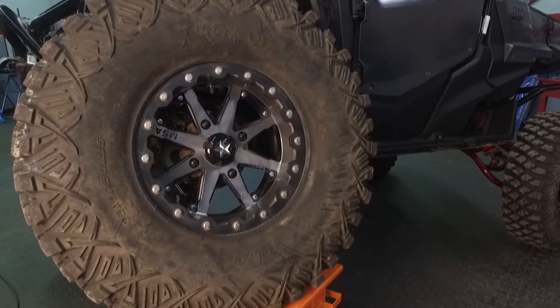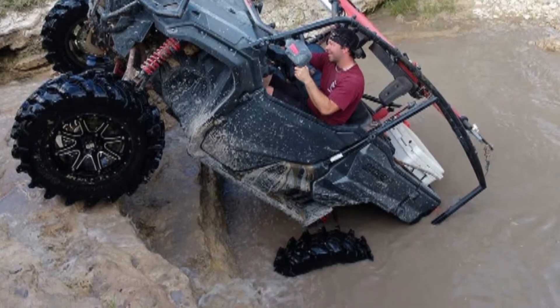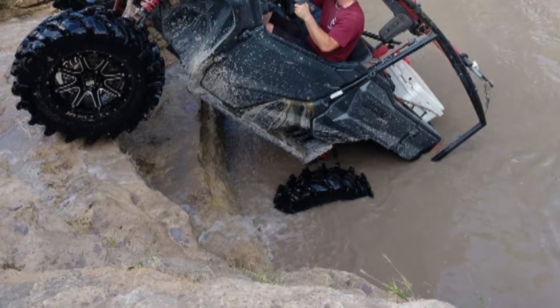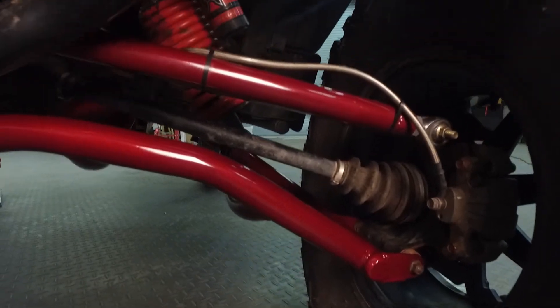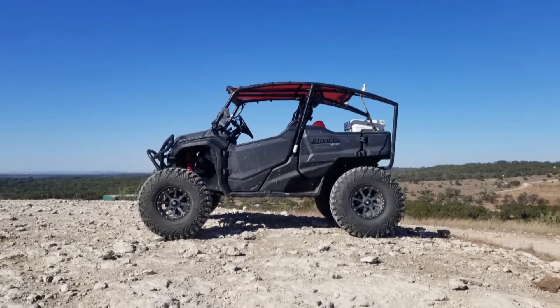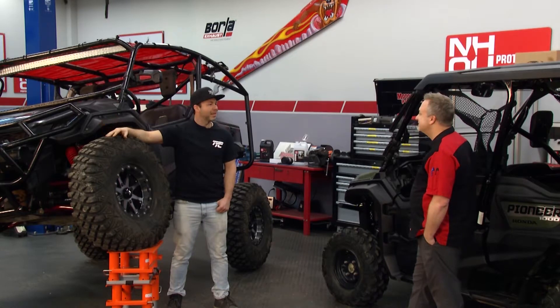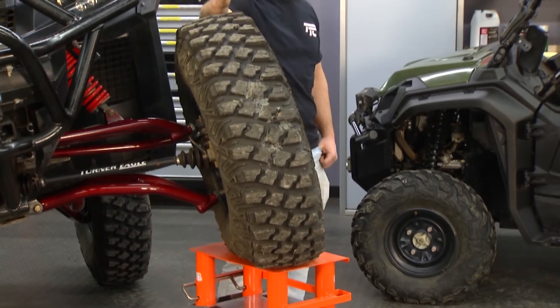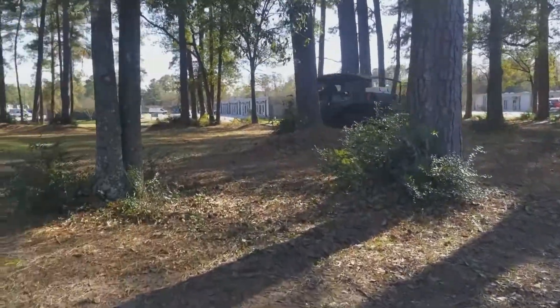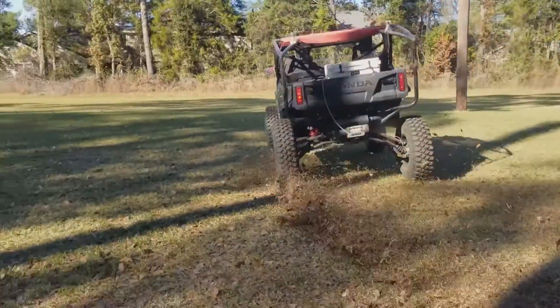You told me the story about this. How did you end up going with this size and discovering how big a tire you could go with? I started with a machine that looked just like this, and I was like, we do too much mud riding, we've got to have bigger tires, so I wanted to run about a 32-inch tire. So I got into AutoCAD, started designing some stuff, did some reverse engineering, and designed a lift. I went and ordered my tires — they were 32-inch tires — and when I went to go pick them up, they looked kind of big. I read on the side they were 34s. I went back in and told them these were the wrong tires, and they said you paid for 32s and you got 34s — you came out on the good side, go ahead and take them home. So I went home, did some redesigning on the lift, modified it, and made it work for 34s. So with our three-inch kit, you can run up to 34s. A happy accident that changed everything.